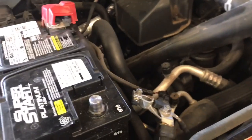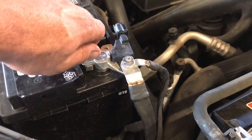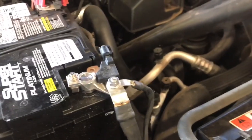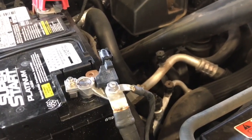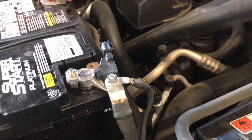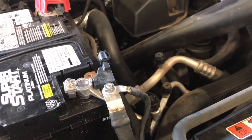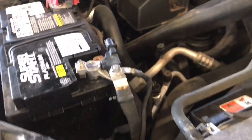Now that we're done installing the pump, go ahead and put the negative battery cable back on, and now we can prime the pump. It's very important not to allow the vehicle to go into the auto stop-start feature because that pump is not yet primed and it can cavitate. Per the Ford service manual, the pump can actually fail if it's not primed correctly, so it's very important to get it primed.